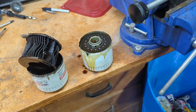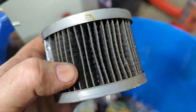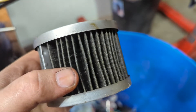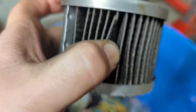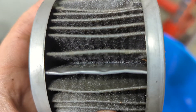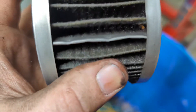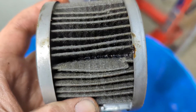The whole reason that I cut these open is not just for curiosity. You take the filter media, and if you were ever having some sort of a bearing failure or any kind of debris inside the engine, you can just look down inside these pleats right here. You can see any metal. So actually, you'll see this one has little pieces of copper right there — stuck back up in there — and there's another one shining back at us, and a bunch tucked down in there.